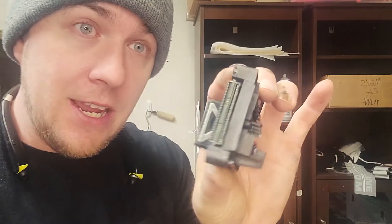I cannot emphasize this enough — these are fragile. If you get water on the electrical connector and you do not clean it off, blow it out, and make sure it is dry when you plug it back in, this could very well screw your entire printer. You might need a ribbon cable, you might need a main board, you're going to need a new printhead. It does not like moisture. And when you put this cable back in, do so gently — it's easy to try to manhandle it in there and end up with a busted cable, which will have little chips off the end of it, and then you're replacing the cable.